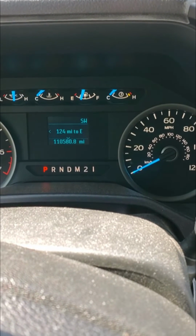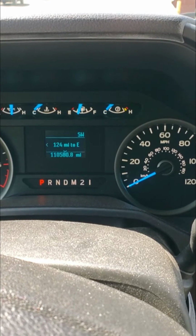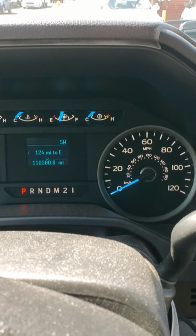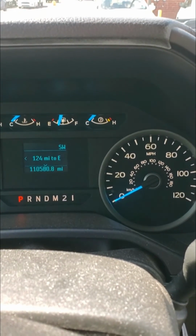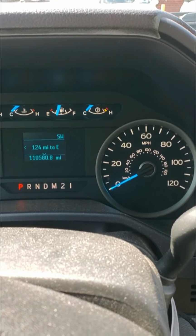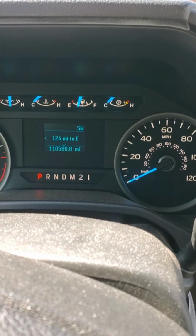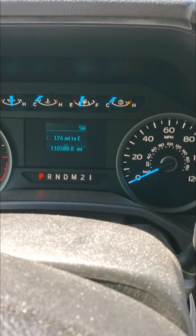Alright, so I just got done road testing. I let the vehicle sit for a couple of minutes, let it cool down. It's actually totally cool now, but the coolant radiator upper hose and Y junction was the fault that I had with the heat concern. When I eventually drained the cooling system, I would say about 3 quarts or so came out. These systems usually take about 1.5 gallons of coolant.